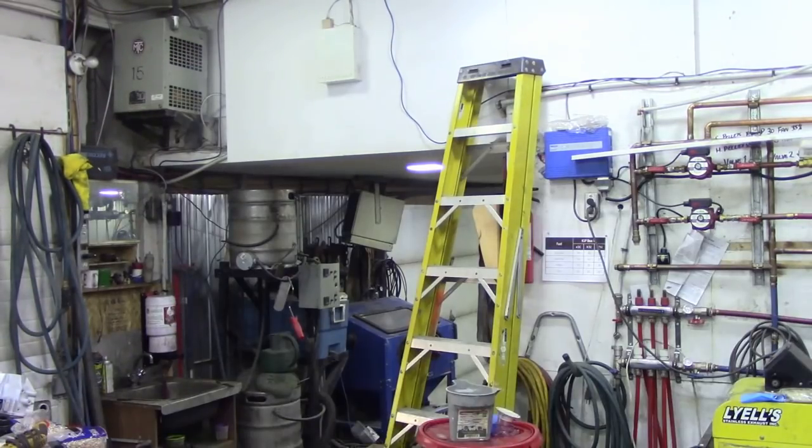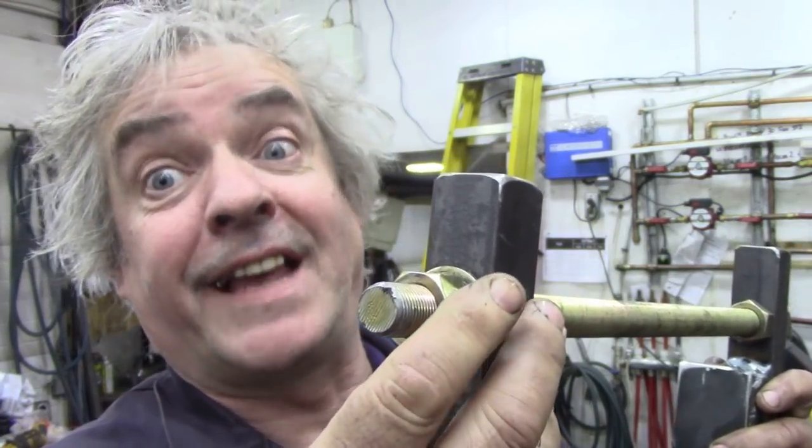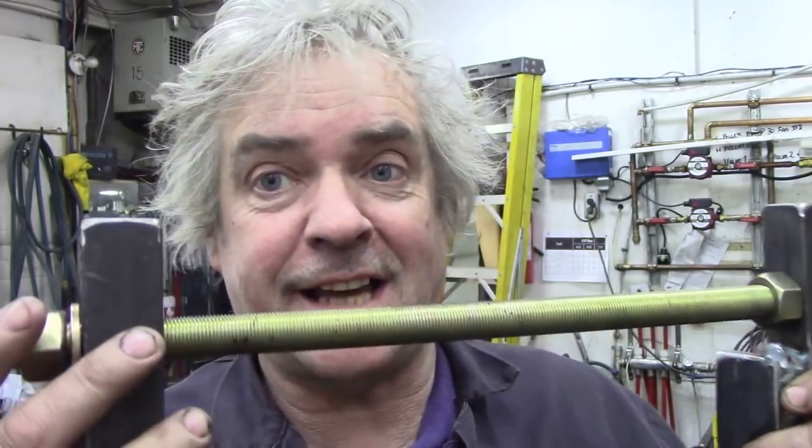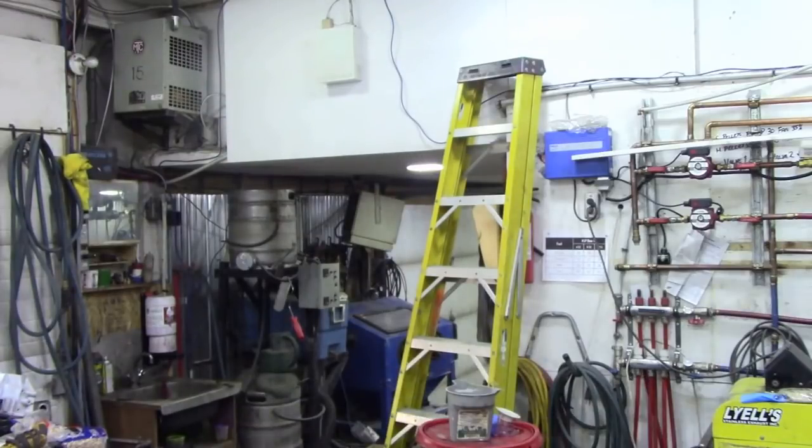Now, when I first used it, somebody said, you know, you've stretched the casings, it's knackered, nonsense. I still had to stretch the casings just a little bit to drop the diff in. Only half a turn. I mean, what we're talking about is one turn like that. That's it. That's all you need. Once the slack's taken up, just a little bit, and it dropped in. So that was a necessary tool, because otherwise you'd be struggling. So I put it all back together again.